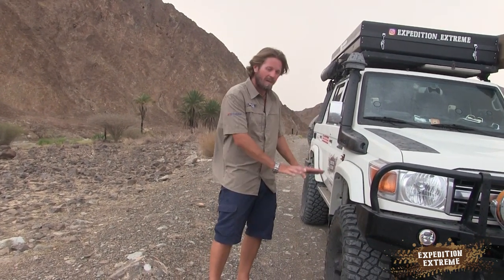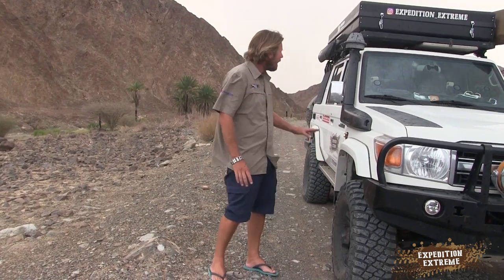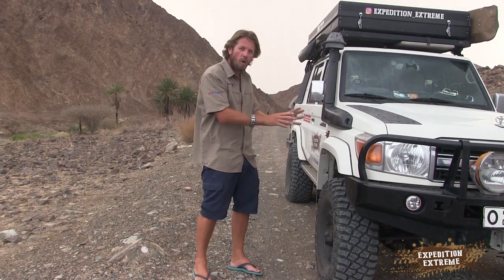Rain is coming down. Wow, it's absolutely awesome. But I want to see if this suspension is as good as they say it is. So I took the setting down, 2 in the front, 4 at the back, with the tire pressure that I've got. I'm going to leave the tire pressure at 25 in the front and 33 at the back right now. The airbag suspension is brought down to 10 psi, which is the minimum you've got to have, so it's not assisting whatsoever in the suspension. So we're getting the true shock and spring suspension test.